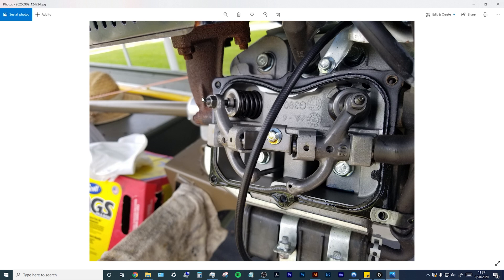These are your valves and rocker arms. We can get into adjusting a little further down, but the main thing is you have a high point and a low point. You can find top dead center, but for me it just seemed easier to go with the absolute bottom and the absolute top. To check the clearance on the valve — I am not a technician or engine guy at all, this is just YouTube research — instead of trying to find top dead center, the easy way is to see which one is the low point and which one is the high point. So if I was checking the exhaust — which is the back one — I would put the intake all the way down, turn the front of the engine, and work it until the intake is at the very lowest point. That takes all the pressure off the exhaust side, and that's how you check your clearance.